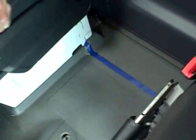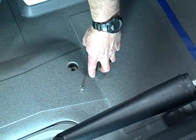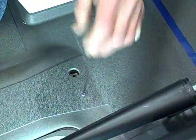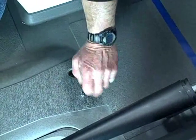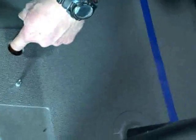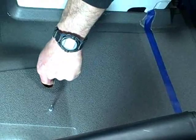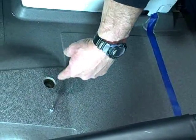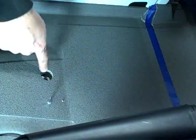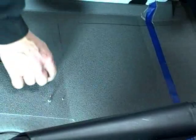The other thing we've done prior to starting the video was mark these holes from the bottom of the Sprinter up. Get a piece of cardboard, lay down under there, and you're going to see about a one-inch diameter circular tape covering these holes in the metal under the mat. These holes exist already and you're going to punch through them with an awl. We drilled through the rubber with a hole saw — it's a one-inch diameter hole. You can run a marker from the bottom up first, then take the hole saw and run it backwards in your drill; be careful not to scar the steel. Just run it backwards so you go through the mat, you'll hear it hit steel, then stop and pull the little plug out.